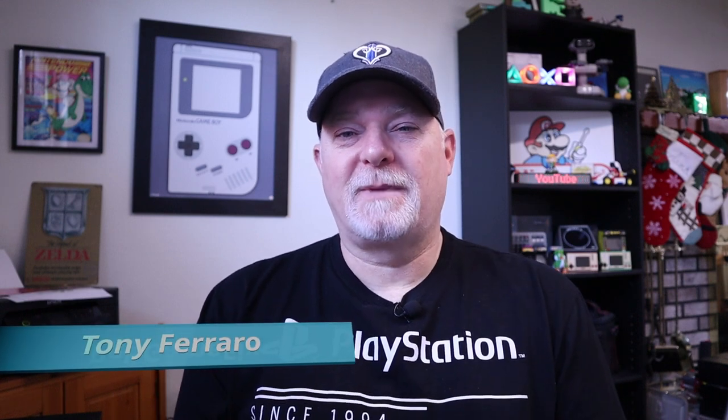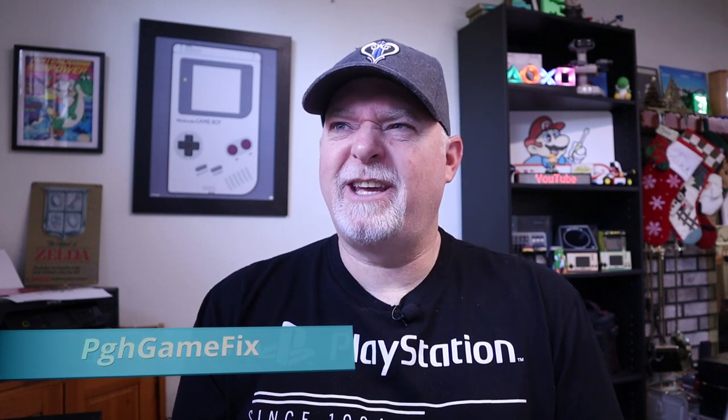Welcome back to the channel. Do you have a PlayStation 4 controller where the buttons seem a little gummy or you're getting some random button presses? Well, there could be a few things wrong with it. It could have a bad membrane, the carbon paths could be dirty, the internal ribbon cable could be worn out, or it could just be full of old Cheeto dust. Fortunately, it's not a hard procedure to pop one of those things open and clean it out.